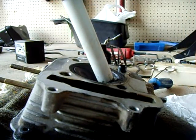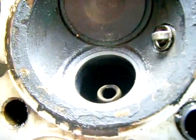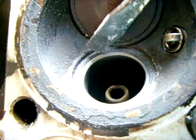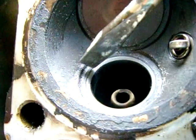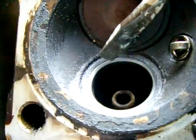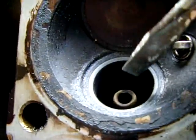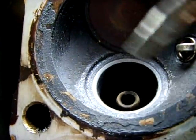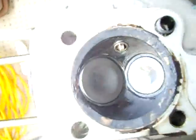That's it — simple process. That's the finished product after you're done grinding. You see this nice band that goes all the way around — that matches the bevel of the valve. That's what you want to see. Now I'm going to do the fine polishing compound on this one, flush everything out with WD-40, and wipe it dry.